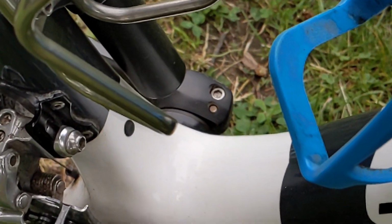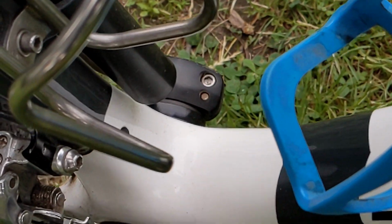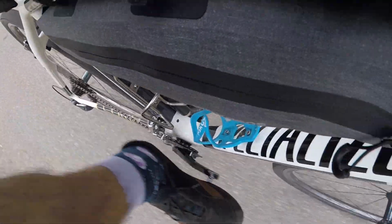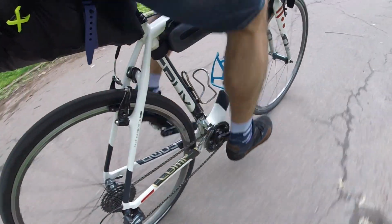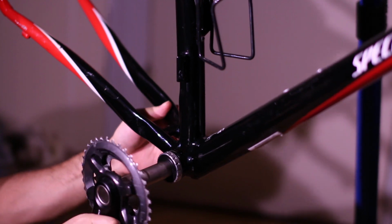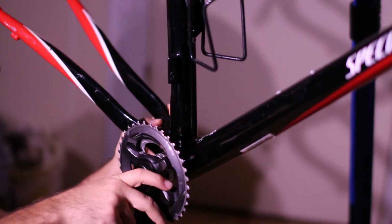While riding, I needed to shift twice to go up and only once to go down, but I had access to the full range of gears and didn't drop the chain once I dialed in the limit screws and the cable tension. In practice, front shifting can be a bit more forgiving than the rear, especially when you're only using 2 chainrings. That said, it was far from perfect, and I was hoping to improve upon it with this build. So I started thinking the E-type front derailleur might be the right solution.